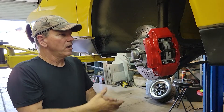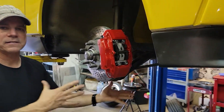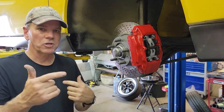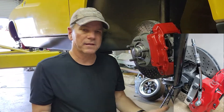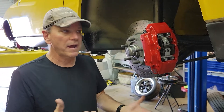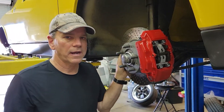On to the good stuff. If you notice, this is all 914 suspension — 914, 914. None of this is 911. For those people that think they're going to go find an air-cooled 911 front suspension, especially a later front suspension where the spacing on the two bolts on the back is three and a half inches proper — not like the early 911 stuff which would be basically the same as 914 — good luck, because it's not really going to happen anymore. The stuff is so incredibly expensive; it's like $4,500 to buy an entire front end, good used, and you'd be lucky if it's not bent. So the 914 stuff is almost identical to the 911 stuff. It's good, it'll work fine.